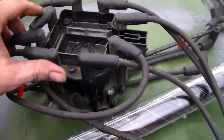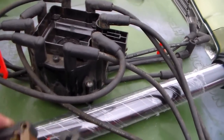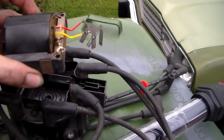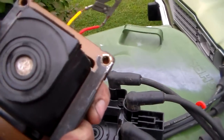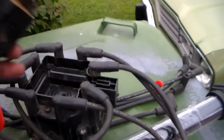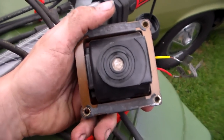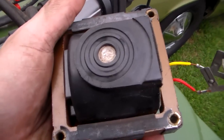I think I found an issue in here, and you guys that have dealt with these as much as I have, you tell me what you think about this. The coil sits right down in this cap here, it does have a ground strap. It sits down in here and bolts down, and it's got a little piece in here that goes up against the bottom of that coil — that's how the coil fires into the rotor button and does its work. But I found some evidence of some arcing here on the bottom of this coil that should not be happening.